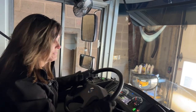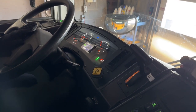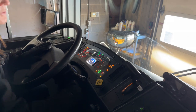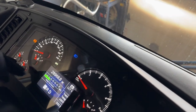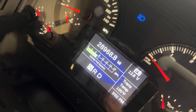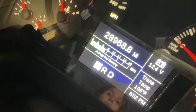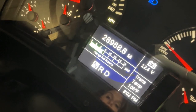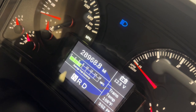Now we're going to put the gear shift back into neutral, turn the bus key off, the engine off, and put it back to accessory so our gauges still function. Now, with our foot off the service brake, for the static brake test we don't want the air tanks to move more than 2 psi in a minute. Ask the tester if they want to time that. If they say move on, press on the service brake with real hard pressure, and make sure that these air tank gauges are not moving more than 3 psi after the initial drop. Ask the tester if they want to time that. If they want to time it, don't release the pressure until they say move on.